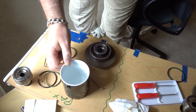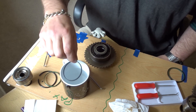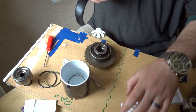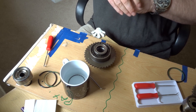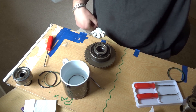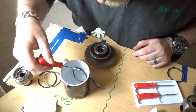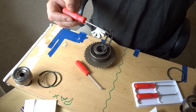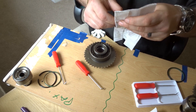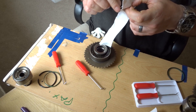Quick pause — I wanted to get a cup of hot water. I'm just going to drop the Teflon seal into the cup of hot water, which warms it up and makes it a little bit softer. Teflon seals can be quite brittle when they're cold, so you want to make sure it's nice and warm. It doesn't make it bendy and flexible — you don't want to distort it. It's been in there for about two or three minutes now, so it's nice and warmed up. Just hooking it out.